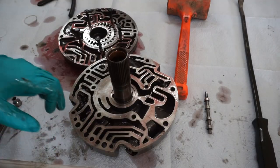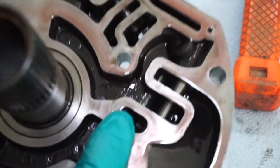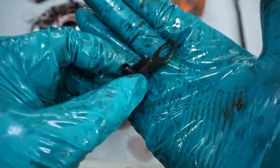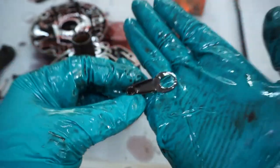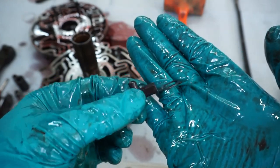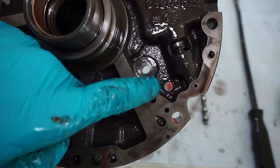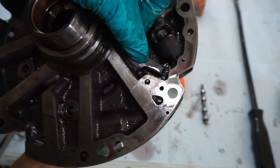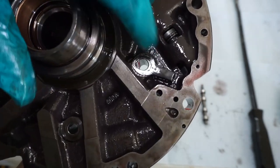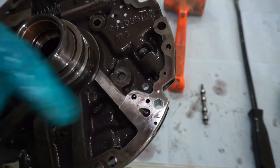This pump already does have the line-to-lube drilling done. You're going to drill a hole through this little wall, and you can see that there is already a hole drilled in that section through that wall. I want to add — because I get asked a bunch of times — this is like a little splash shield. It actually goes on the backside of the pump. Sometimes it'll fall off and people will find this thing on their table after they're done with the transmission wondering what it is. It goes over the bolt hole and this little elbow goes right inside there. It's not a deal breaker if it doesn't go back in, but it's just a little splash shield for a lube hole.